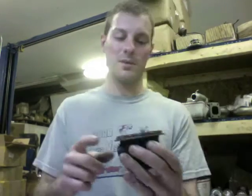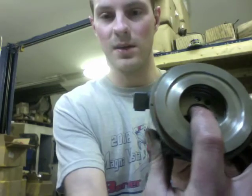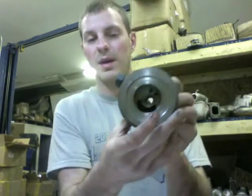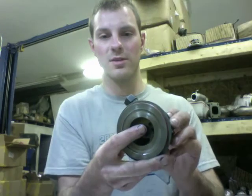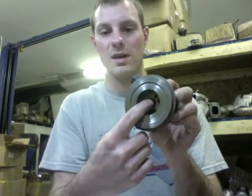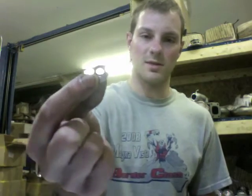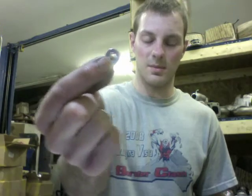Before you get started with the rebuild, you do have to grind right here. If you're using our kit for the upgraded thrust collar, there's a better video on that — go to the Evo 9 turbo rebuild kit instructions video which shows you exactly how to do that. You do have to grind so the thrust collar will fit, because it's a 14 millimeter upgrade. That is kind of a downside of our kit, so just keep that in mind.